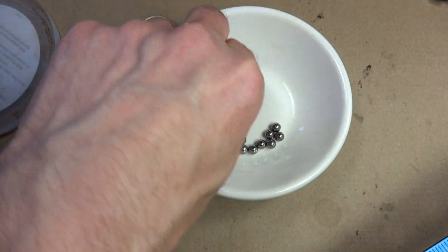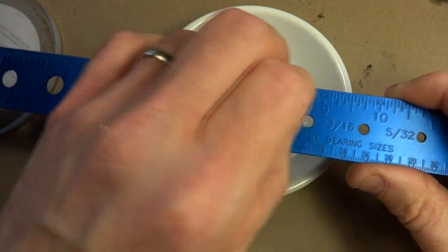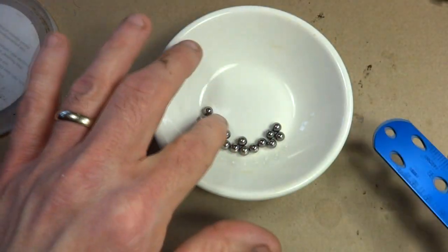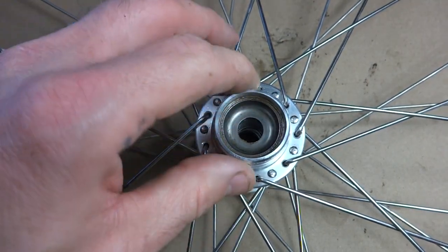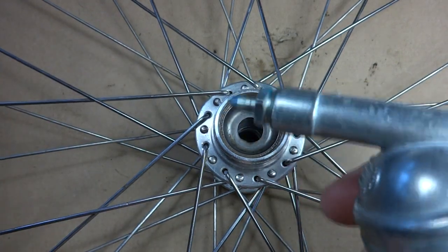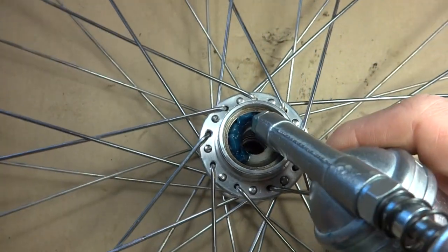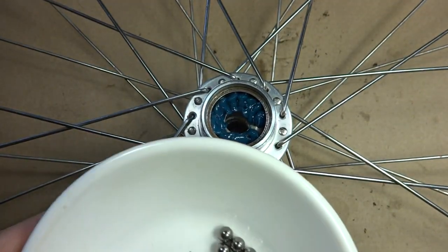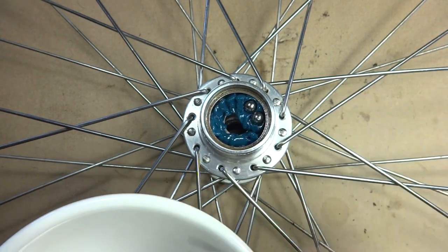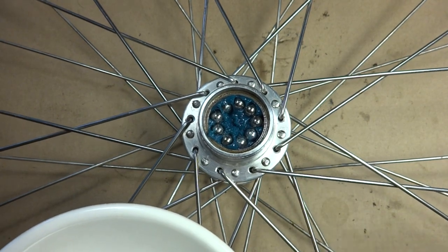Here are the bearings I pulled out of the hub. I've got my spoke bearing gauge from Park Tool — they're not 7/32 inch bearings, they're quarter inch bearings. I have a bag of the quarter inch bearings and there are 18 bearings, 9 per side. I've checked the cups for any obvious damage from having the axle bent, but everything looks good. So I'm going to use my mini grease gun to put some grease into the cup, then insert the nine bearings. Let's go ahead and do the other side now — nine bearings on that side too.